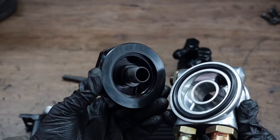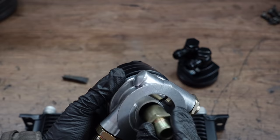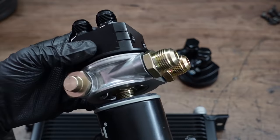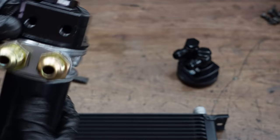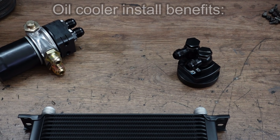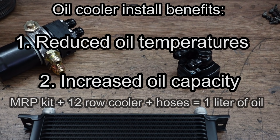You can install it both under the oil filter or under the mounting bracket on the engine. Inside it, the thermostatic plate has a proportioning valve which sends more oil to the cooler the hotter it gets. The end result is an engine that gets to operating temperature faster, but also doesn't over cool its oil. In general, installing an oil cooler and oil filter relocation kit doesn't just help by keeping your oil cool, it also increases the oil capacity of your engine, which is always a good thing. In my case, installing the MRP kit together with my very small oil cooler actually increases my oil capacity by around one liter.